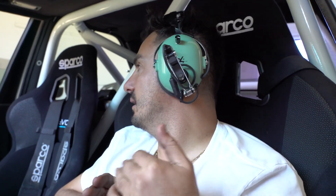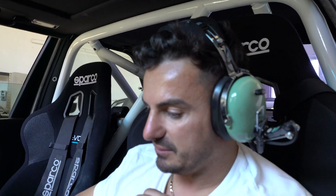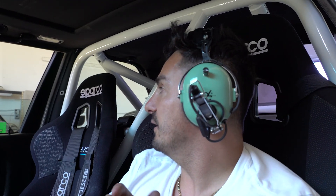This thing doesn't care too much about AFR. I ran it where I'd like to run, then added 5% fuel and took away 5% fuel across the pull - that tells you right there what AFR the motor wants. It wants to be at around 11.7 AFR. That's probably because of the compression. Typically on pump gas they run 12.4 to 12.8, but because the compression is so high, the burn gets hot. It doesn't like to run lean because the burn is already hot. When you go richer, it provides more cooling and is less prone to detonation, so it gains more power.